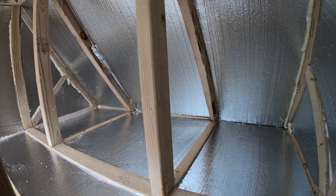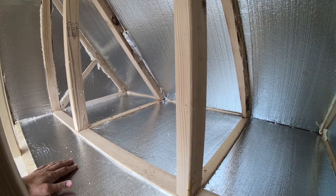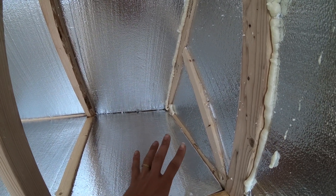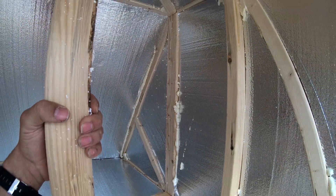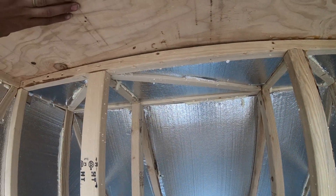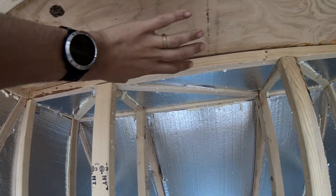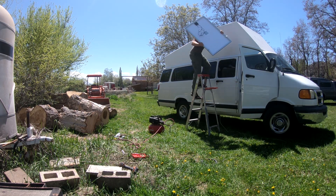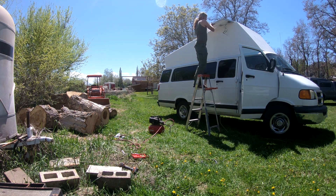This is what the front of the van looks like — I've got it bolted to the actual van up front as well as in back. I've got it all sealed internally along all these edges as well as externally, so if the external seals fail the internal seal should still prevent any moisture from coming in. I've got one-inch insulation same as everywhere else, and whatever gaps I could find I put spray foam in. I haven't insulated this one yet because this is where my vent is going to go. Initially I'm installing a 100-watt solar panel — I don't have many power needs, not trying to run a fridge, so 100 watts should be plenty. I'll be running the solar panel into the van down to a charge controller, into my battery, then to my fuse box and out to all my items.